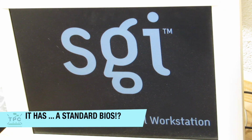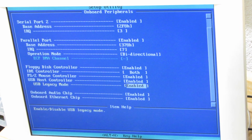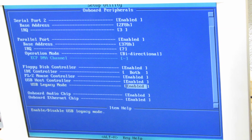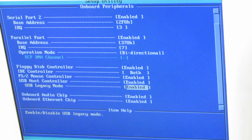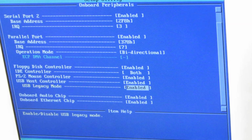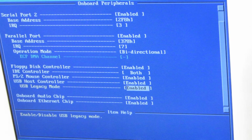And with the CMOS battery being replaced, I'm off to reconfiguring the BIOS. And I will have to deal with the BIOS because it yells at me about a missing keyboard, since I'm not using a PS2 but a USB keyboard here. So I have to temporarily hook up a PS2 keyboard in order to perform the BIOS configuration, by necessity enabling legacy keyboard support in there.